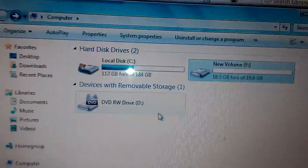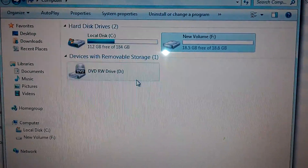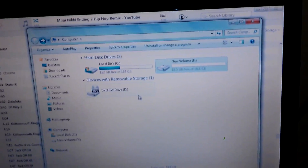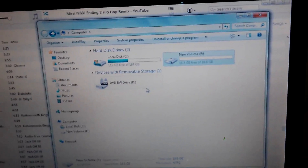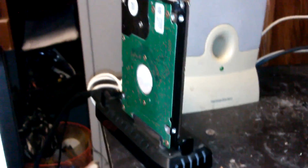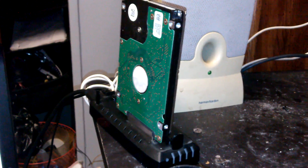That's all you've got to do — it's that simple. If you have an old Xbox hard drive or you have an Xbox that's dead and just want to use the hard drive, depending on what size you have you can use it for multiple things. You can take it and throw it into a laptop — as long as you have it formatted to NTFS you can use it to install Windows, though I don't really recommend it since they're not very fast hard drives. For storage and whatever other needs you have, you can use it for that. It's a 5400 RPM 20 gigabyte drive.